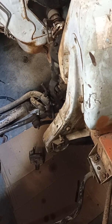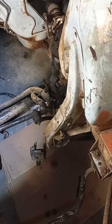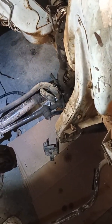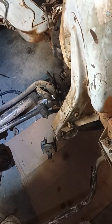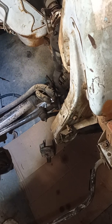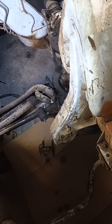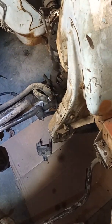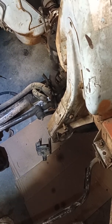I'm going to do a more modern front end eventually, but I'd like to get this running and driving with the current front end first. I also haven't decided whether I'm going to do independent rear suspension, but if I don't do independent rear, I'm going to do a four-link. I'm going to get rid of the leaf springs in the back — that's going to happen. It's also going to get an Explorer 8.8 with rear disc brakes.